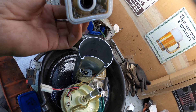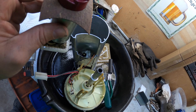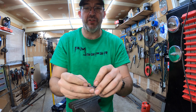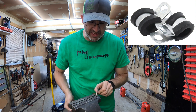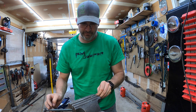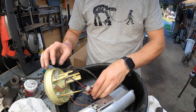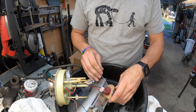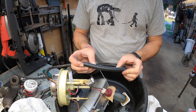I'm going to go ahead and get some gasoline-rated rubber hose and some clamps, and just put a clamp right on there and then put the hose to the underside of this. These are just little brackets I got off Amazon — just thin metal coated, so we'll flatten these out. So I got the pump completely disassembled. I already did this once — I threw the pump back into the vehicle with what I'm about to do and it did work. I went out and got a 3/8 fuel line and cut it — this is probably about 6 inches or so.